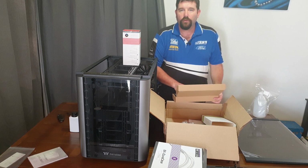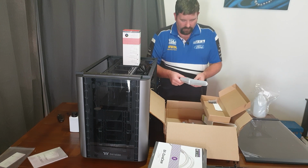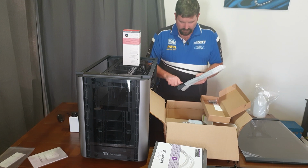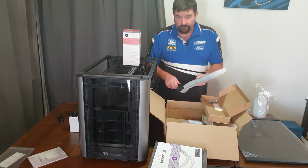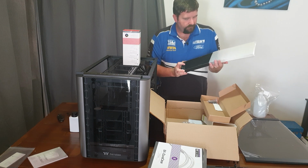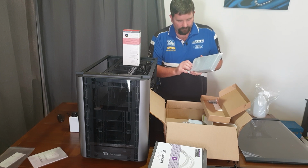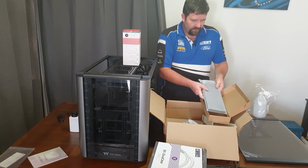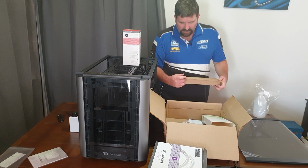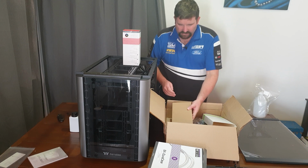Keep up to date. I will no doubt do other videos on the build to let you know how things are going. Another thing I need to do is apparently clean the radiator. It's always advised that you clean the inside of the radiator before use, just in case there's anything left over from manufacturing in there, plus any corrosion that's already started to happen from the air gets cleaned out.